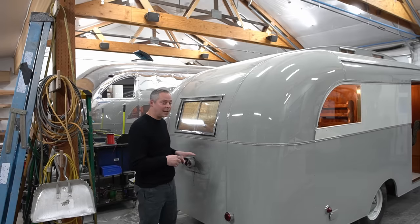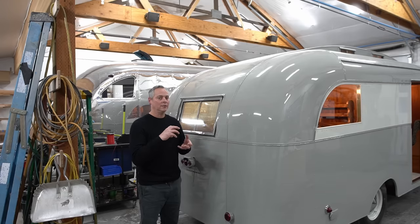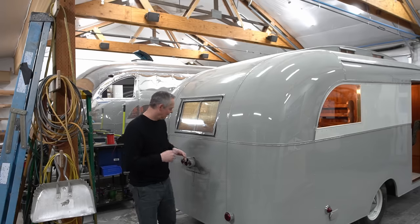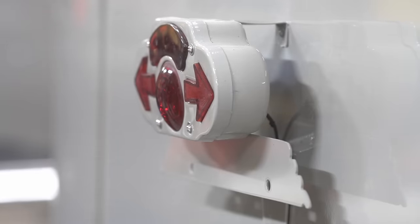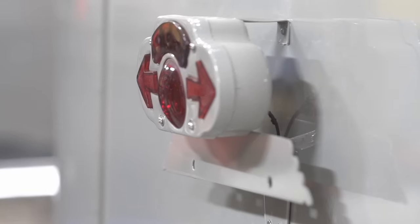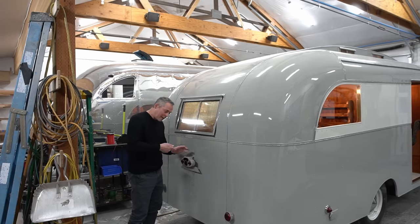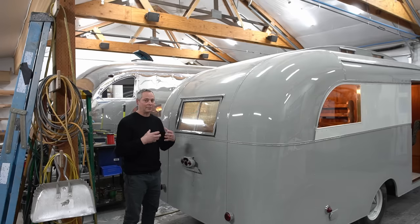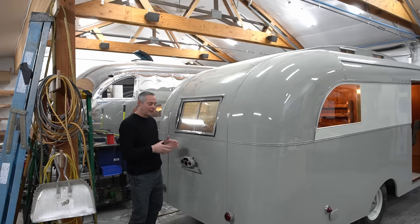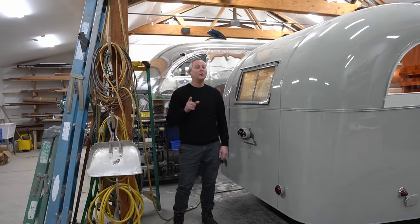One more thing I want to show you is the tail light and the license plate holder — this is just the coolest piece on the whole trailer. We did have parts of it, but a lot of it was broken and very rusted through. This was the only tail light on the whole trailer. It has turn signals on each side, a stop light, and a running light in the center. And this right here is your license plate bracket — look at how ornate and all the work that went into that in 1938. They didn't spare any expense. What we had to do was reform all of this casing, pound it out, stretch it and form it, and then all of the lenses had to be recast in resin. We laid them up in rubber forms and recast them all in resin to give it the original look. It's got to be the original tail light for this one-of-a-kind two-window Westcraft.